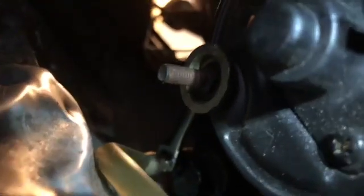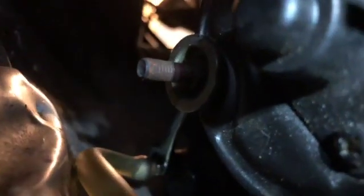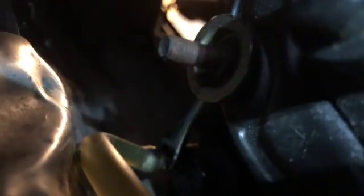All right, I'm back under here again because with it under pressure, I have a pedal. The pedal comes back, but as soon as I depressurize the system, I do not have a pedal. So what I've got now is my lovely assistant. It's just gonna push and hold the clutch pedal down. I'm gonna re-bleed it, see if we don't get more bubbles, and then I will tighten it back up again before she lets the pedal off. All right, here we go.